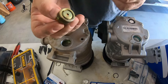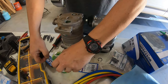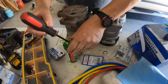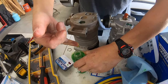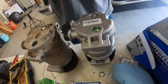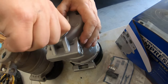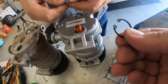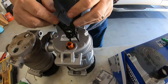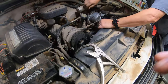Make sure that's clean — it's pretty dirty, so we'll clean it. That's cleaned up. Before you put that in, you want to lube up the O-ring. We're just going to use some of that PAG-150 oil, which is what we're putting in the system. Just put a little on my finger, put it on the O-ring — just enough to moisten it. There we go, and the clip. Just make sure it's sealed so we don't lose it. Looks good.